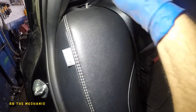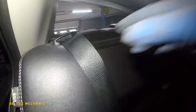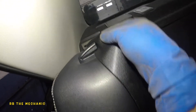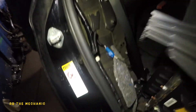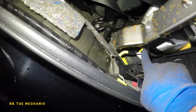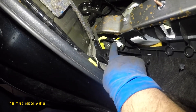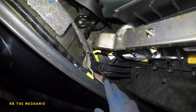To take the seat belt off, just slip it through that little gap and it comes off. Then push this up and pull it forward a bit - you see this little anchor right here, it sits in a slot. Anything yellow is an airbag line - you don't want to yank it. If you do, you're going to cause the airbag warning light to come on and potentially deploy the airbag. You don't want that.